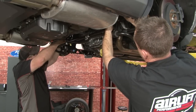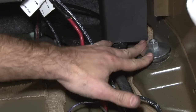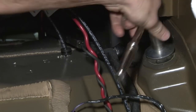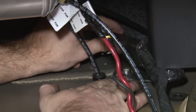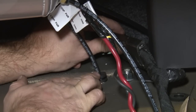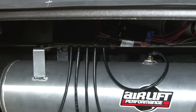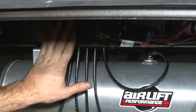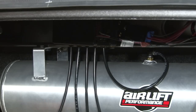Let's go ahead and install the shock. We've got the shock through here, upper nut reattached, tightening it down. The stud that came up through the trunk gets a nut and washer. We're also putting a grommet around the airline so this sharp metal doesn't cut the line. Now we're buttoning things up in the back — all the airlines are ran. On the manifold itself it will say FL for left front, and everything is marked so you know where to run your airlines. We'll leave the lines a little bit long in case the owner wants to hide things more neatly.